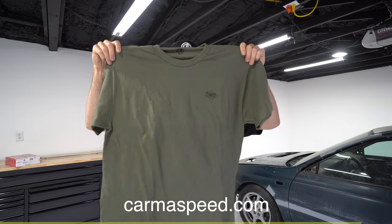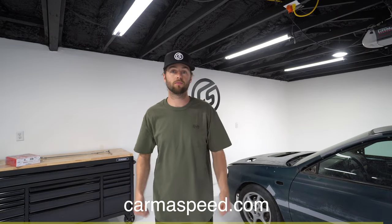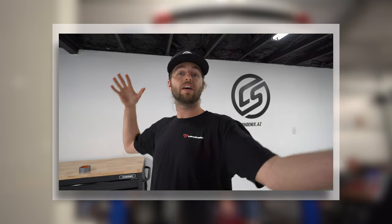After installing the supercharger, we ran into some issues with the car slipping on the freeway. We got a new clutch from ACT today and we installed it. I've never pulled a transmission out before — it was a lot of work. I had to have some friends come over. I ended up putting it in and out a couple times. I figured out that the MT82 transmission in these Mustangs is one of the largest physically manual transmissions ever made, so it makes it a huge pain.